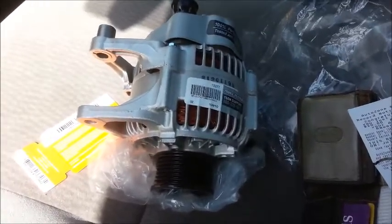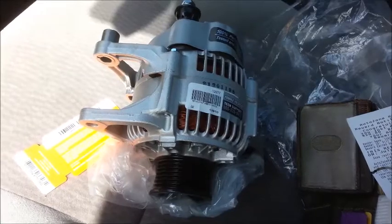The new alternator is here and I'm going to swap it in. When the lady at AutoZone tested the alternator for me it actually passed, which was kind of weird. Her explanation was that it happens quite frequently on that machine — it'll pass but won't work in the customer's vehicle, possibly because they can't replicate the voltage load. When you hook it up to your own vehicle and battery, that's the real voltage load. Quick stop at Starbucks to recharge with a coffee first.